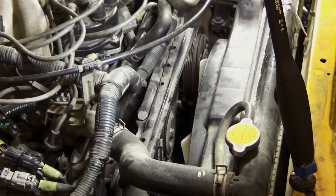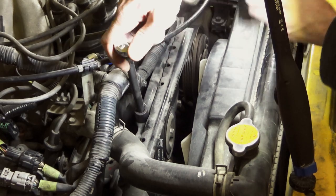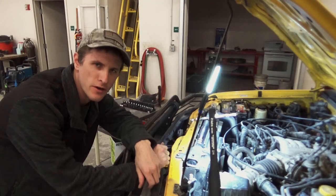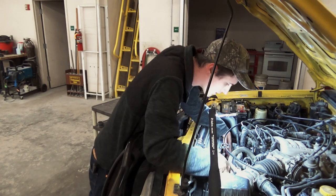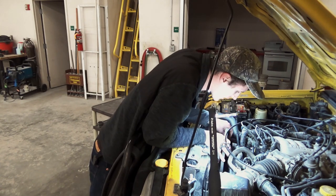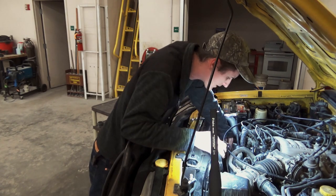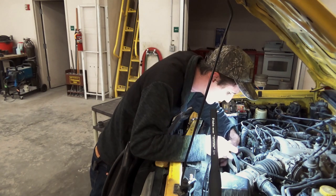You don't have to loosen it up a ton. Then over here you can see — this socket is the jack screw. As you turn it in, you can see the idler is moving down and taking tension off the belt. You need to turn it far enough that you can simply slip the belt off, then route it around the fan. It might actually come out easier from the bottom. This belt doesn't drive the water pump — that's the other belt.